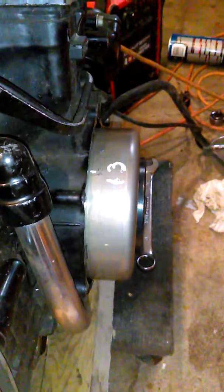Once I get these done, I rotate the crankshaft until the 3 lines up with the index line, and then I adjust these valves over here, and then give it another 270 degrees and do cylinder number four.